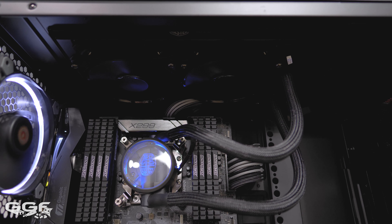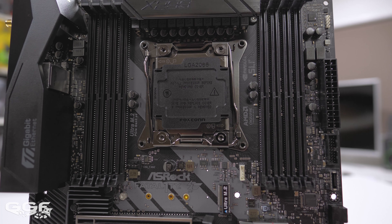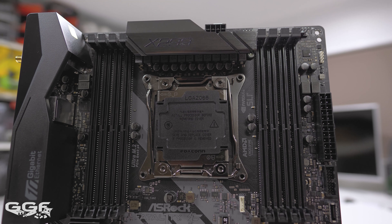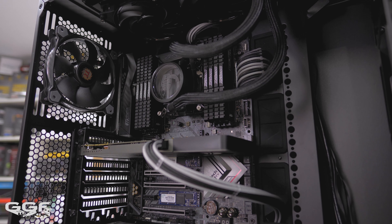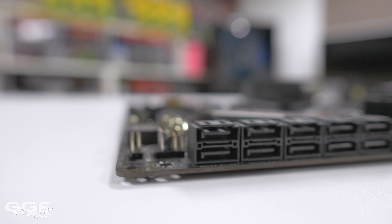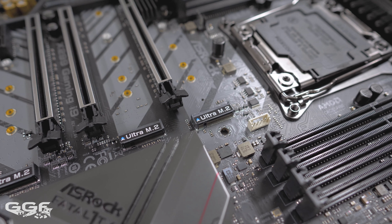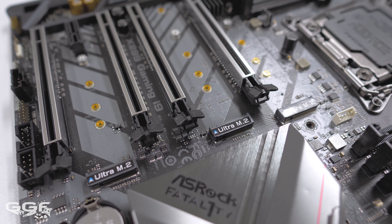On my test bench I can only conclude that these much cooler temps are caused by the Cooler Master all-in-one cooler mounted up top, pulling air directly over the VRM heatsink. Memory support goes up to 4400 megahertz plus OC, with support for both quad-channel and dual-channel memory configurations, depending on whether you're using Kaby Lake-X or Skylake-X CPU. Storage-wise, there's a total of 10 SATA 3 connectors — 8 running off the Intel chipset and 2 via an ASMedia ASM1061 controller.